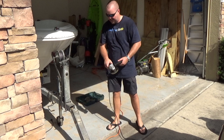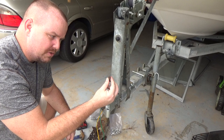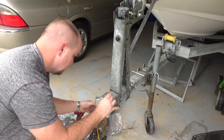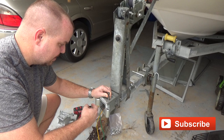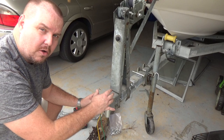And there it is — I have to finish cutting the bottom, but it'll be short enough to fit in the garage. Now let's stick it back on. You also get the tool necessary for the bolt top — it's a star-shaped socket — and you get a punch. When doing this, you want to punch all your holes and then drill with different size drill bits. I'm going to punch the hole, drill it to hold the piece in place, then drill the rest so nothing shifts and I don't have holes that are out of place.